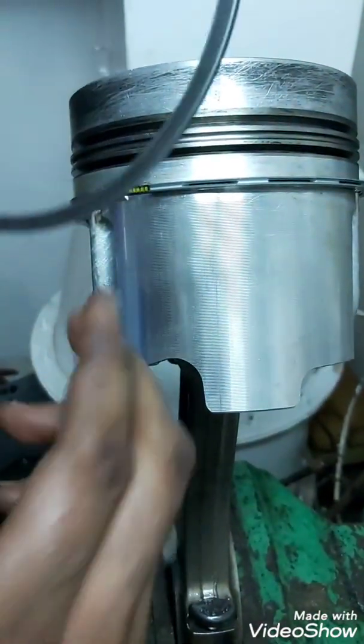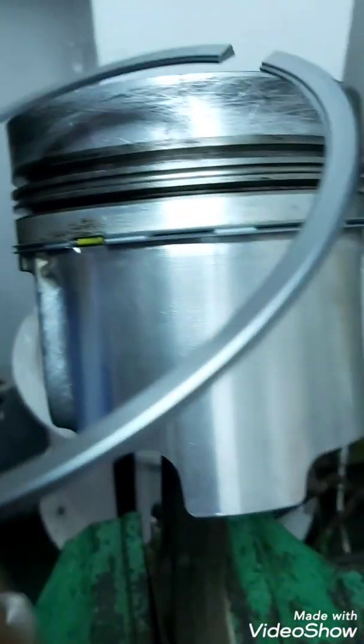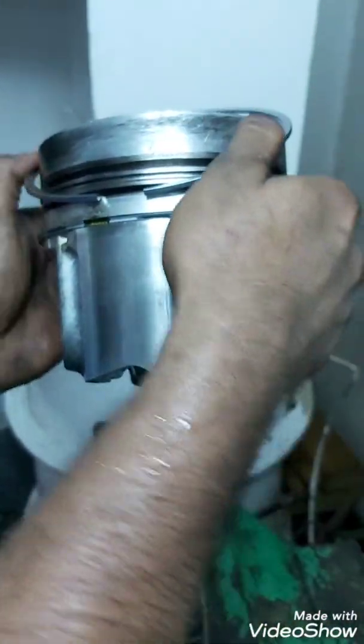As you can see, the yellow marking is at the opening of the piston ring. This is the middle ring — there is a groove there, as you can see. Also, there is a number on the piston ring; the number should come on top.